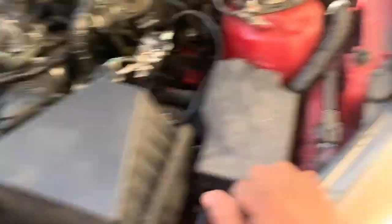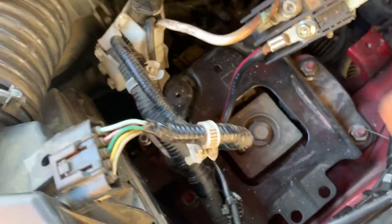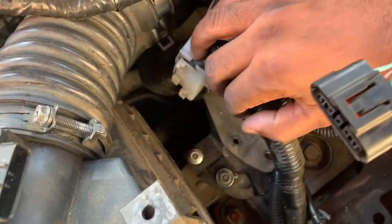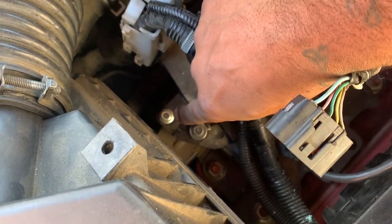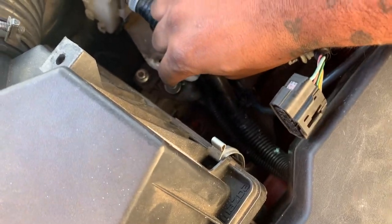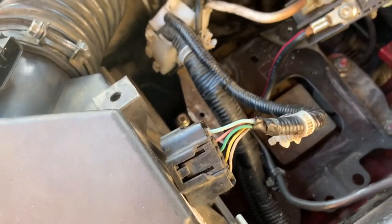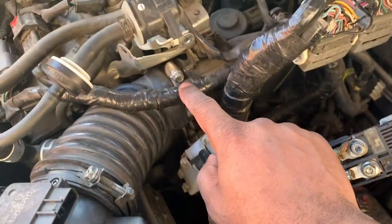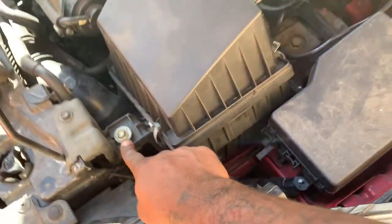Alright, I'm back. I took the battery, battery box, and tray out, and I took the little cover off the intercooler. Next, there's a bracket here — it's going to be two 10mm bolts, one and two. Loosen those and take that bracket off. I like to put the bolts back on so I won't lose them. Then this piece will come off. Next step is to loosen the airbox so you can take it out.